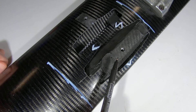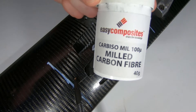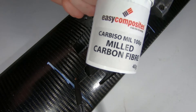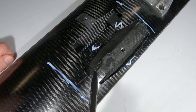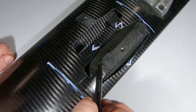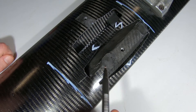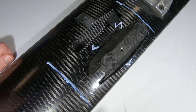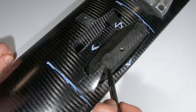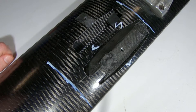In order to bond the replacement rib in place, I made a mixture of epoxy and Cabosil milled carbon fiber to make quite a thick paste, then put that on both the inside of the new rib and also the outside of the existing rib. I've put some peel ply on it just so I have to do less sanding to get it ready to bond the next layer on.